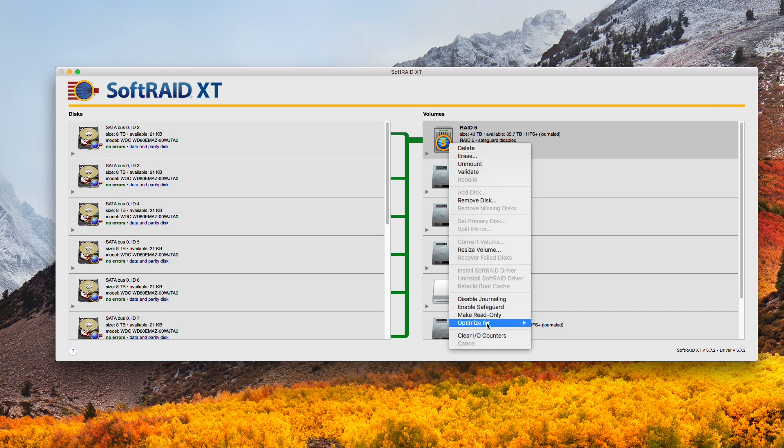When you right-click on your RAID, you'll see an option that says 'Optimize for' with various options you can set the RAID up for. I don't know specifically what these change about the RAID's function, but since I'm doing video production I set mine to 'Video' and left it at that. The Thunder Bay 6 supports RAID 0, 1, 4, 5, and 10.